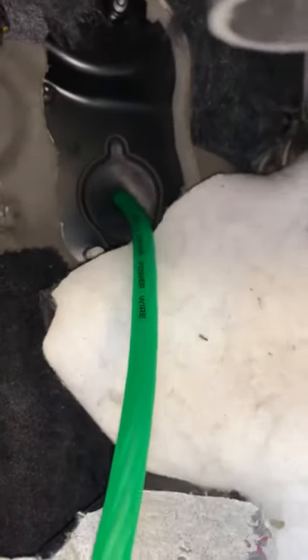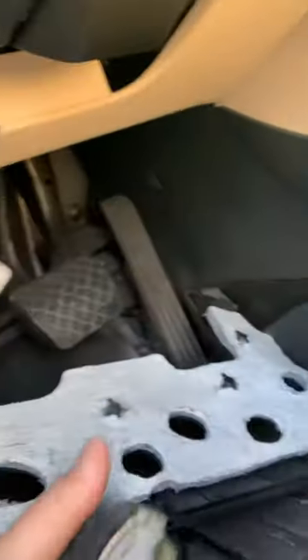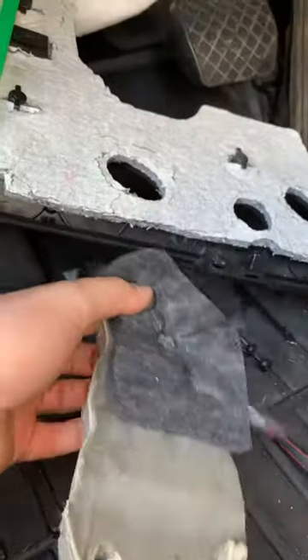You also want to pull out this little glove box right here — it's very easy, just pull it down, push these tabs up, and it slides right out. Then pull down this plastic piece and push down this other insulation — it will be up in here like that. Then you'll see a little cutout in this big gray wall of insulation. It's kind of hard to find; it blends in really well. You're going to want to pull that out.